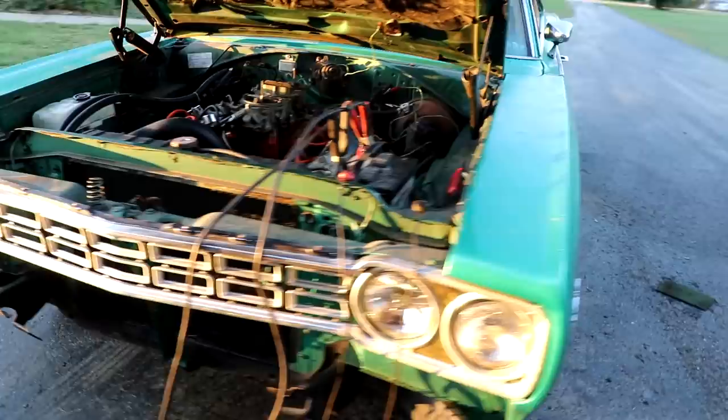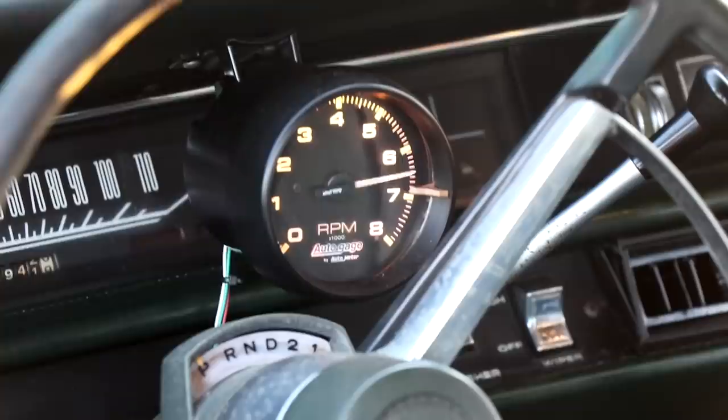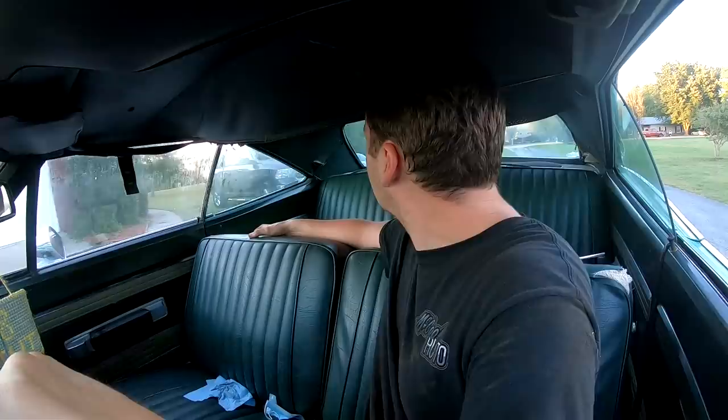Going for a drive, see how she likes it. The battery is really weak. The tach is jumping all over the place. It does that whenever it gets really low. That's always good. Good news is that the torque converter seems pretty road friendly. That's first. Second works. Third, so the band adjustment was the problem.